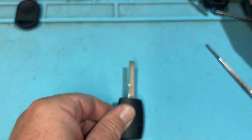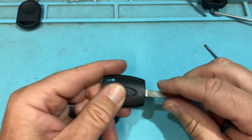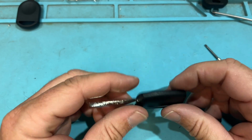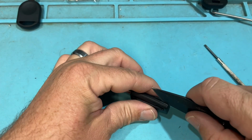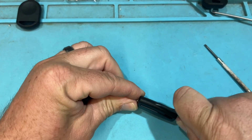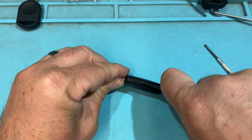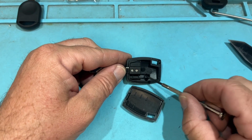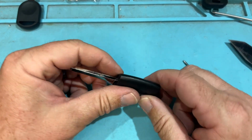And now we have our high security. This is like for those 2019, 16 type vehicles, like a Ford Edge, like their backup key. We notice, hey, there's a seam there, pretty straightforward. And oops, see, could have cut my fingers. So I'm gonna press like so. Cool. And in there, wiggle. Cool. You have your chip right there. You can put your glass tube or other chips there. That's pretty cool. Close it, it clips, we're good.